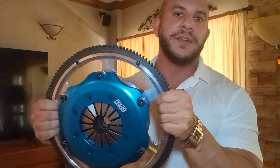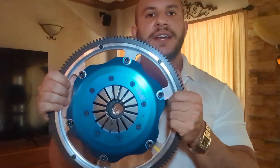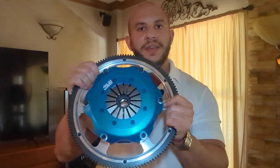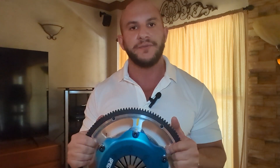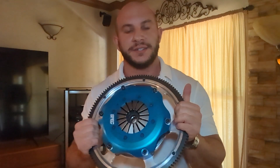What this ultimately means is that we have a reduced moment of inertia and also much less rotational mass from the lightened flywheel made from aluminum. This is going to allow us to have a very quick rev, so the engine will rev almost like a Formula One type car or a Le Mans style car, especially considering we have 25% more displacement from another rotor. It also helps with wear on the dog rings for the transmission between shifts, helping to facilitate quicker shift times through the pneumatic system.